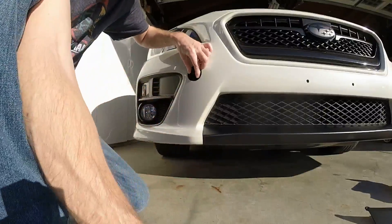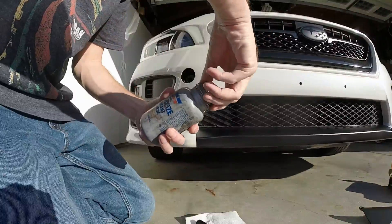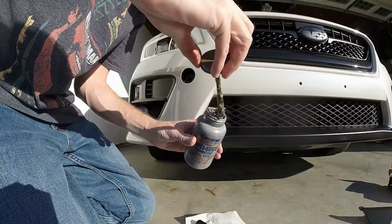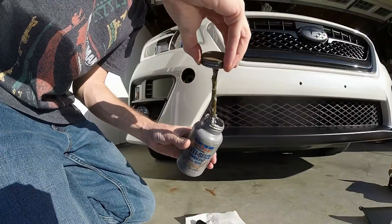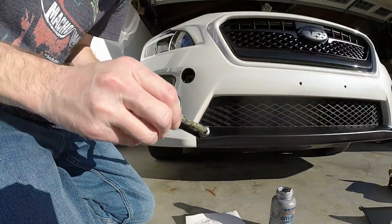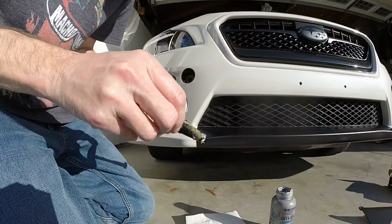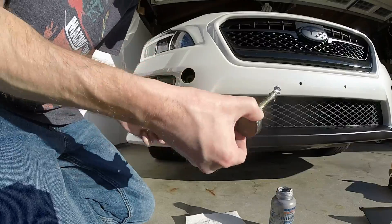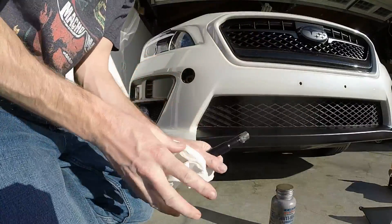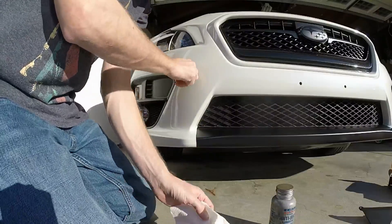You know what, they told me every place to put some anti-seize on this. I want to do that — I'm gonna take it back out. This one doesn't have to be high temp so it's not the copper, this one just has to be the regular silver stuff. It's goopy. That's more than enough but just to be safe. Screws in a lot easier now too.